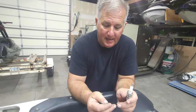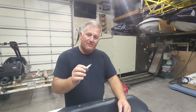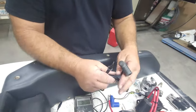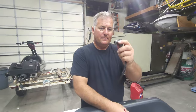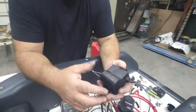Now you have a spark plug with almost 5,000 ohms of resistance. This NGK spark plug cap is a fantastic product, however there's also a resistor built in here — 4,700 ohms. And this OEM Kawasaki cap also has 5,000 ohms of resistance. These did come after 1990 and were stocked on the 650s, but this ignition system was designed for no resistance on the spark plug lead. So stacking these gives you roughly 18,000 to 20,000 ohms total resistance in the system.